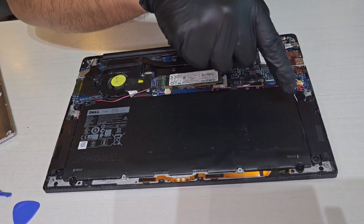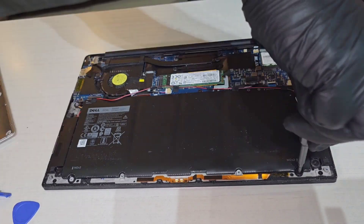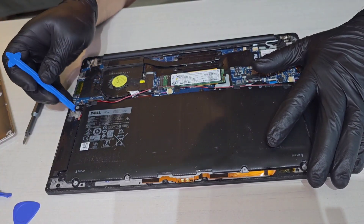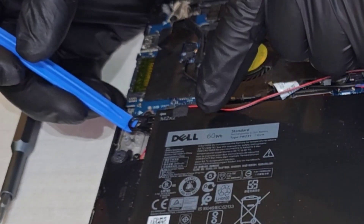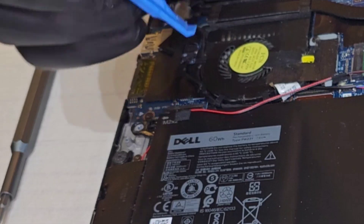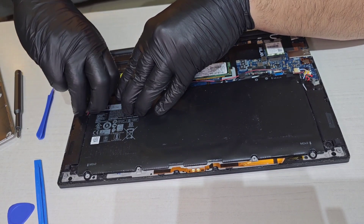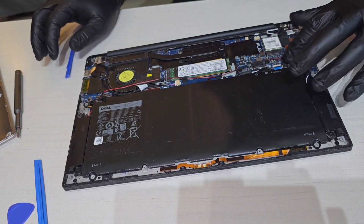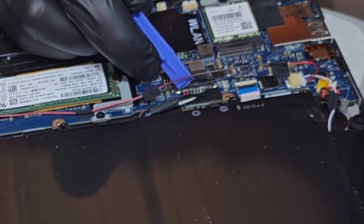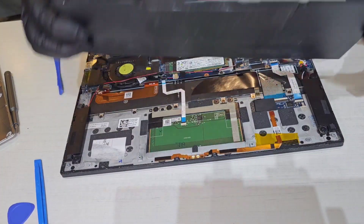And that's it opened. We'll take out all the screws holding the battery. The battery should come right off. Let me just use my tool and lift. You see a wire and it's stuck — you don't want to pull everything off because it's all attached to one another. So you want to just peel off the... there's some tape here, I think. And last but not least, there is a cable here you want to disconnect — this connects the battery to the main laptop. There we go. Cool. We are halfway there.